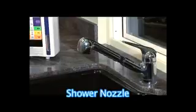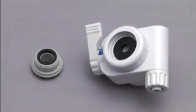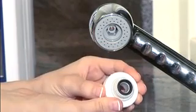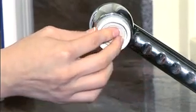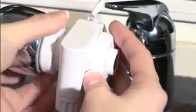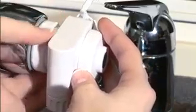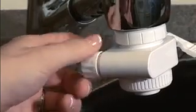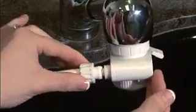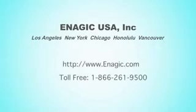If you have a shower nozzle type, you would use these two diverter accessories. For proper installation, screw the correct faucet adapters tightly into the faucet. To tighten adequately, use a coin like a quarter to tighten the nozzle and adapter. Lastly, set the diverter into the faucet adapter and tighten, making sure it's firmly in place. Once again, remove the hose ring from the diverter and insert the hose ring into the white water supply hose. Now, attach the hose with the hose ring to the diverter. If you have a different faucet type, please contact our Customer Support Center for further instruction.